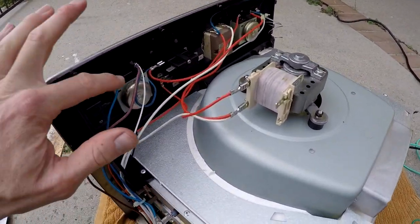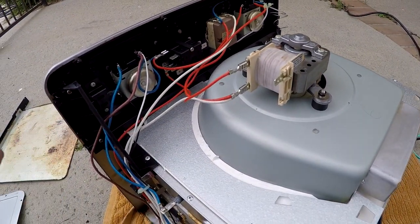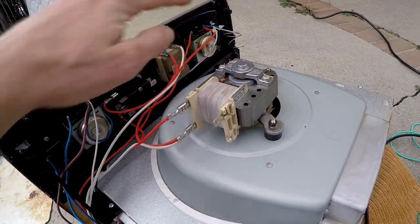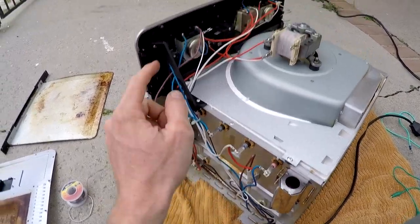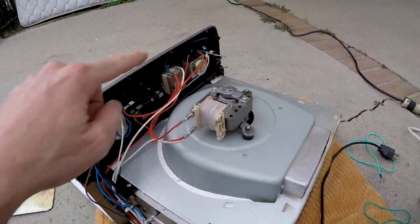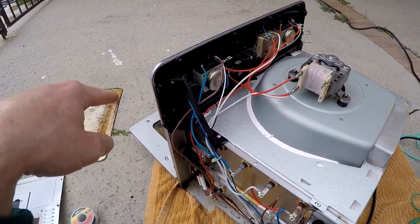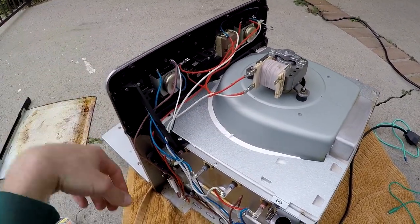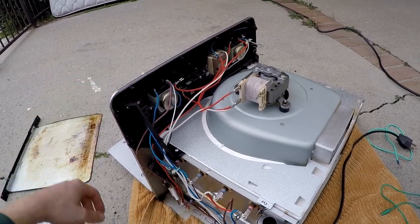I have the two timers. Instead of having seven different cook settings, I'm only having two. It's going to be: this timer turns on the outer heaters and this timer turns on the inner top one — like heat and then extra heat. I realized the toast timer is probably on a different time scale, going up to like an hour, while this one is probably 15 minutes. So if you want to cook it faster, just turn this one up too.